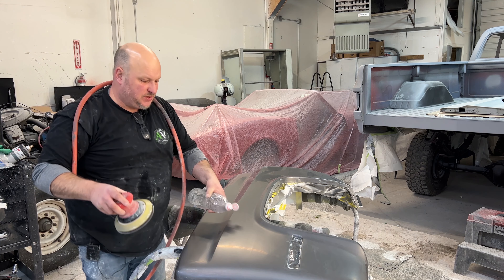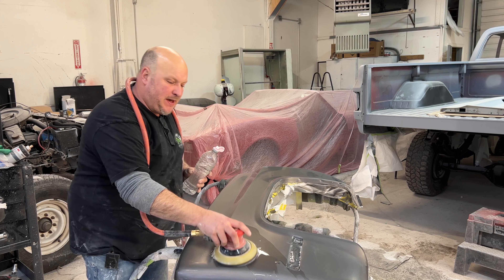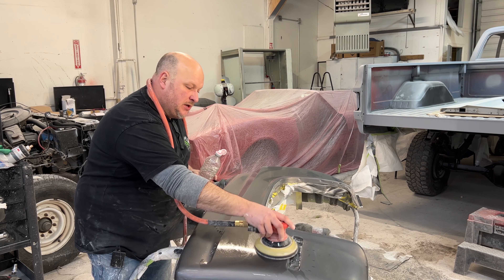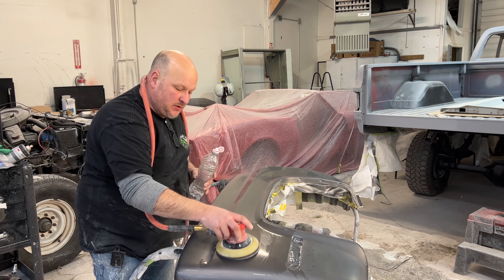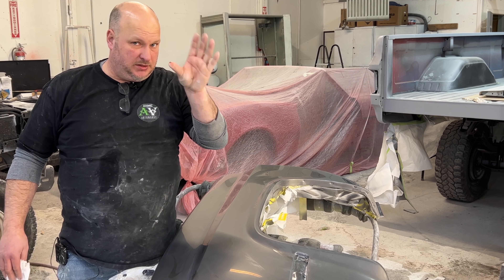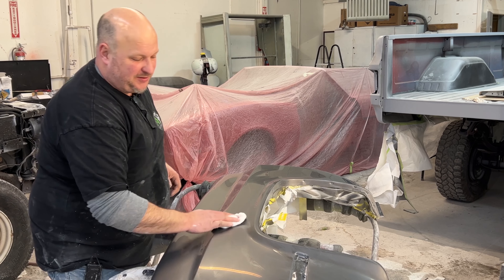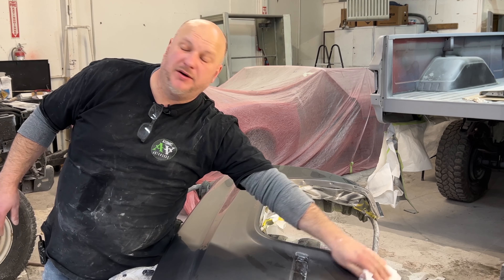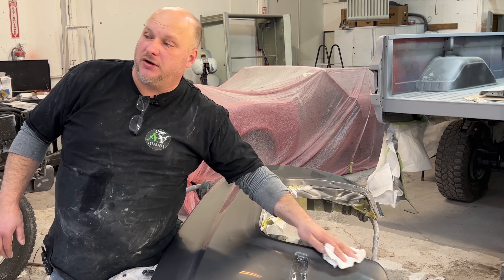I also forgot to mention — I like to use a new piece of paper for the whole setup: 600, 800, 1000, 1200, 1500, 2000, 3000, 5000 — every time I change a panel. It's easier to make sure you cut the scratch below, because sometimes when you're reusing paper, 1000 grit might wear quicker than 800, and then you're not really taking out those scratches. Here is the 2000 — you can kind of get the gist of it, starting to get a little gloss to it. With the 3000 I'm going to do 8 passes the same way, and here is the 3000 all sanded — it's starting to get pretty shiny.